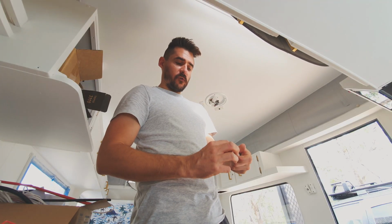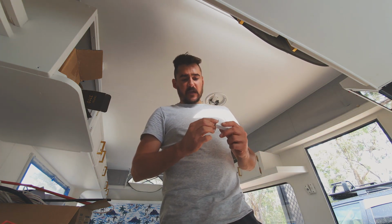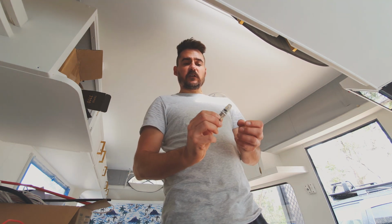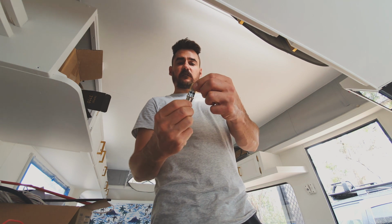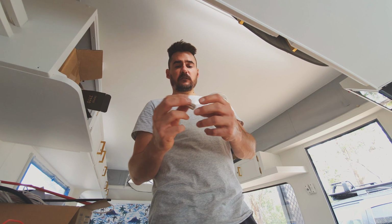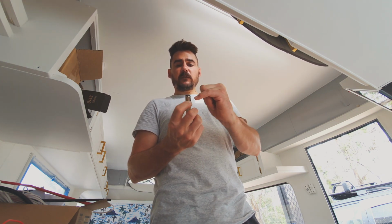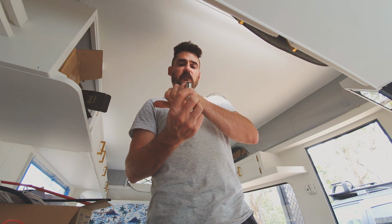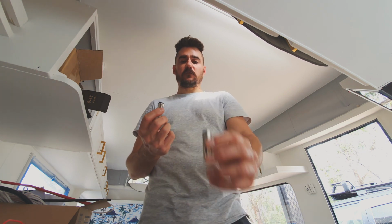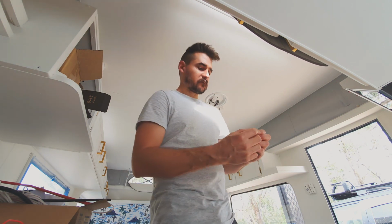And these are just a warm white, 12 volt, Bay 15D bulb. These are pretty cute. They've got a silicone cover on them, so it's sort of soft and spongy. Stops any sort of corrosion, I guess. The Bay 15D have 2 pins at the bottom, and then the 2 lugs are evenly spaced on each side. There's not a raised one. So that's a positive and negative on the bottom, rather than the single ones, which have positive from the bottom, negative from the side. So let's try this one out.